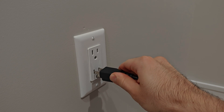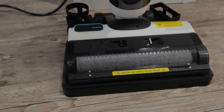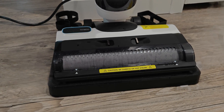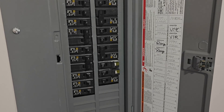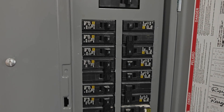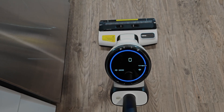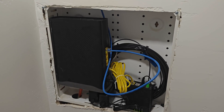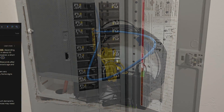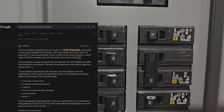I was a bit worried when looking for a floor cleaner that would pull too much power for a standard apartment electrical circuit, especially when steam is involved. The S5 Steam is rated to pull up to 1440 watts, which is a lot, but it won't pull that amount all the time. A circuit on a 10-amp breaker will not be able to handle that load, especially with other heavy power-draw devices on the same circuit — a circuit rated for at least 15 amps would be best. That 1440 watts may only occur during the heating up of the steam element, so having low-draw devices on the same circuit may be fine, since breakers are designed to trip only after a sustained overcurrent.